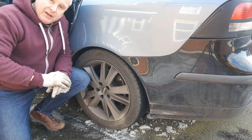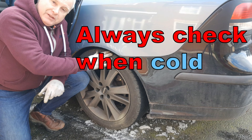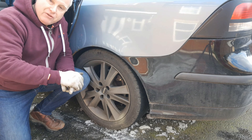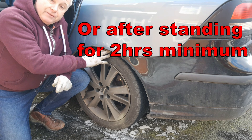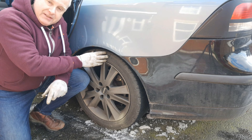Useful information and a caution: always check your tyre pressures when the tyres are cold. That's best done in the morning before you've done any driving during the day. If you must do it in the evening or after driving, Michelin's recommendation is to allow the car to stand for two hours and then test the pressure.